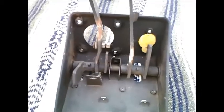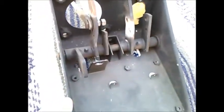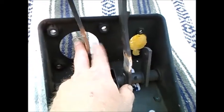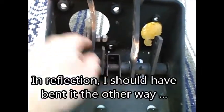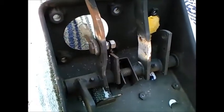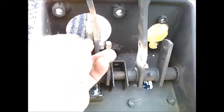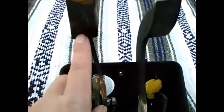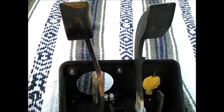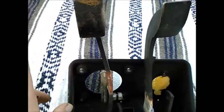Here's the pedal arrangement I had been using up to this point — another TR6 pedal box that still has a separate brake and clutch. What's changed is where the TR6 would have a clevis on both sides of the brake pedal — I bent it. You can see it used to go this way; I bent it that way, so I could line up this shoulder bolt and rod end arrangement, which is actually off of a pickup truck. That's lined up with the master cylinder and bent in the direction of the gas pedal. The new one has the brake pedal near the gas pedal beyond this surface — I couldn't possibly bend this one all the way over there and have it still work.